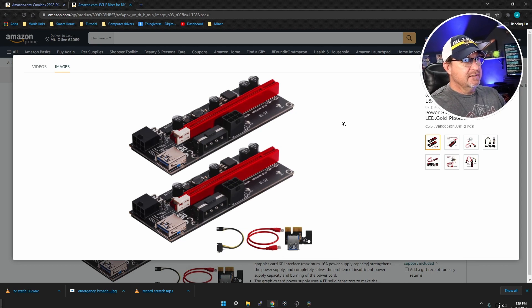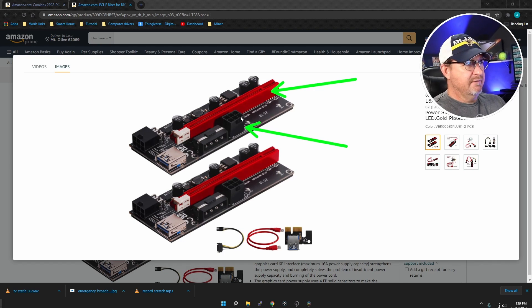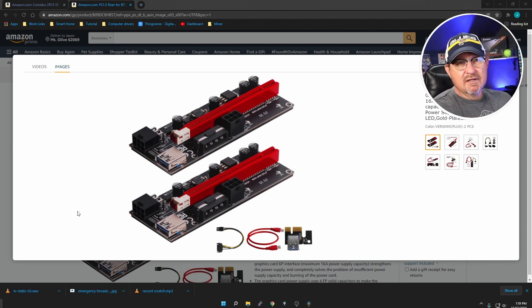The other reason I wanted to keep a motherboard was in case I need to add another SAS expander card and need PCIe power. To solve that I bought a pair of these risers for about fifteen dollars — cryptocurrency miners use them to hook GPUs up, running a six-pin power connector from the supply and a USB cable to the mining machine to control the GPU. I can use that same setup to power a SAS expander card, and it'll draw a lot less wattage than a GPU. I'm also switching out to a couple of molex fans temporarily while I sort the fan tray.